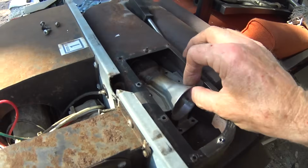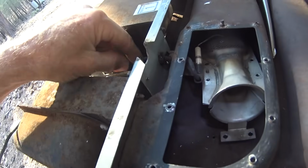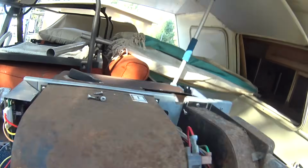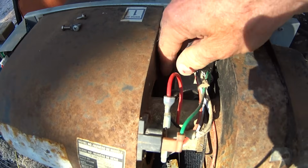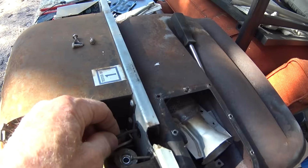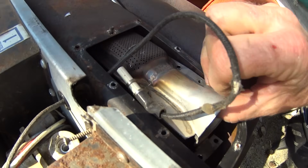Okay, now at this point you want to try to feed some line through here for this igniter. So actually you better disconnect it from the coil first. Just pulls right off. Then you can pull it through this side. You may have to go underneath first and make sure it's not zip tied to more wires under there, but I've already done that, so then you can just push it through here, get you some slack there, then you should be able to pull this out back this way,